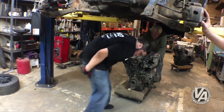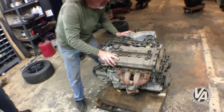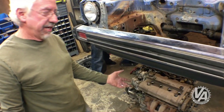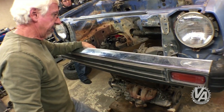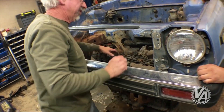I think I'd like to try the D16 from the '87 Integra. The last motor is the D16A1, out of an '86-'87 Integra. There's also a black valve cover version from the '88-'89 Integra that would actually be a little bit easier to convert to OBD1, which I think is what we're going to do — use OBD1 electronics on this. Let's see how it fits.